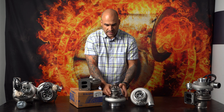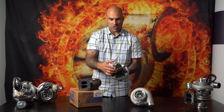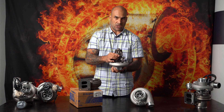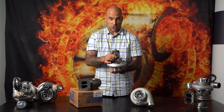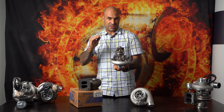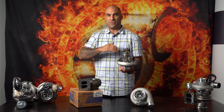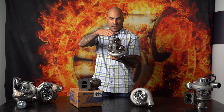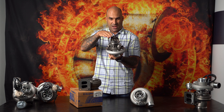The turbine wheel is a 10-blade wheel with a really low back pressure. What we normally do when guys start running high boost pressures and want to use this for circuit racing — where they want punch response coming out of corners, feathering the throttle and immediately coming onto it expecting power delivery right there and then — we have CNC cylindrical grinding facilities in-house where we'll actually go and grind a cutback onto these blades.